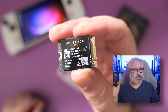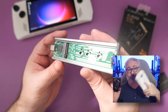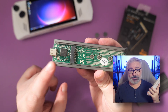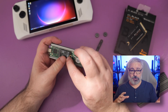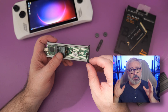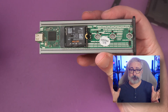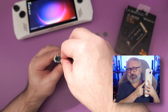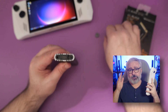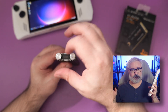Next up, we need the new WD Black SN770M SSD in a portable drive enclosure. These can be had for very cheap off Amazon and the like. And as a bonus, once we're done, you can put the drive you're replacing from the ROG Ally back into this case and have a nice external drive for whatever you need. These external drive enclosures all look a bit different, but inside they're more or less identical. You slide the WD drive into the socket — it only fits in one way around, so you cannot get it wrong. Lock it down with either a latch or a screw, put the case back together, and plug it into your handheld. I would highly recommend using a USB hub with power pass-through or your dock, so you can keep the device powered and connected to mains power the entire time, to avoid the battery going flat halfway through.